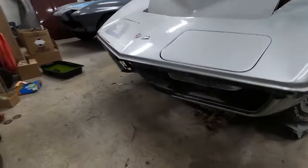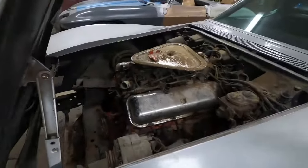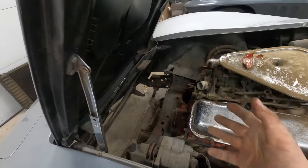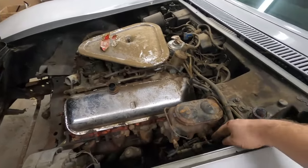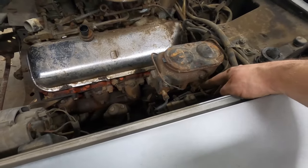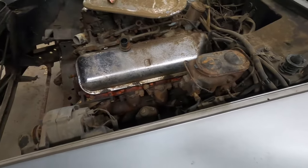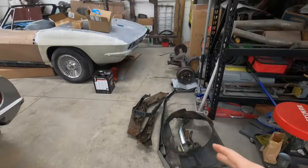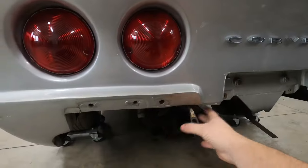It was a little bit of a battle but we got it knocked out. I have the front bumpers and all the bumper brackets out of here. I had to remove the water pump, I had to loosen the alternator to finally be able to wiggle out the fan shroud and the radiator — that was a little bit of a chore. But I got those guys out, disconnected the brake lines, and I see what Derek from Vice Grip Garage means about making sure you lube up this junction — heat and lube — so it doesn't just twist off the brake line. This one came free, that one didn't, but we're going to put new brake lines in here anyway so that really doesn't matter.